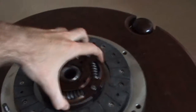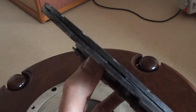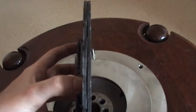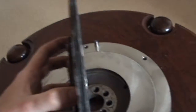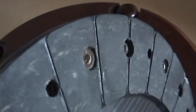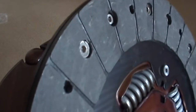If you look at this friction disc you might think it looks really worn out, but this one is brand new. Unlike brake pads, there isn't a lot of material on a friction disc — only a millimeter or a couple of millimeters. What you look for is the rivets — you can see there's quite a bit of material before you get to those rivets, which means it's good and brand new. If it's worn all the way down to the rivets, it's most likely slipping, and your clutch needs to be replaced.